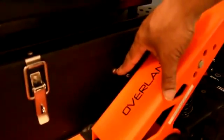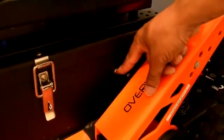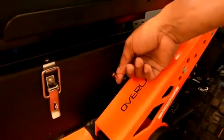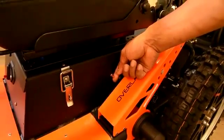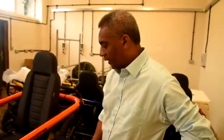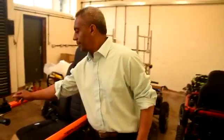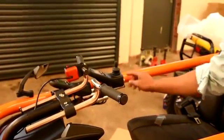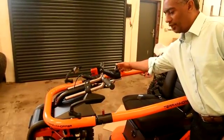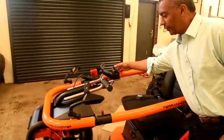Located in this position, there is a switch. This switch is specifically part of a backup system for the servo on the joystick. Occasionally, what we've found is the potentiometer in the servo malfunctions. In recoverable situations, this will still enable you to drive the buggy if the servo or pot has failed. For example, it allows rotation, but it does not return to its centre position — it gets drivable, but with some difficulty.